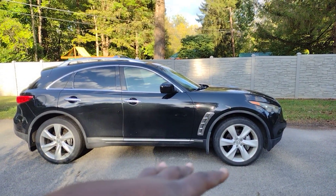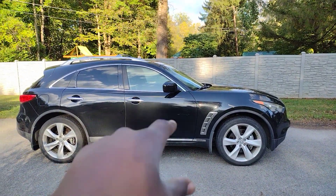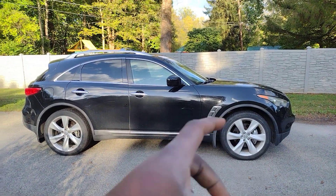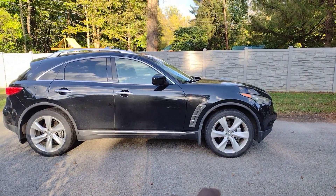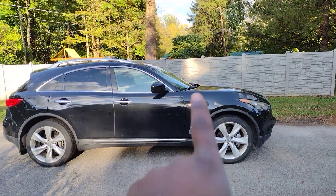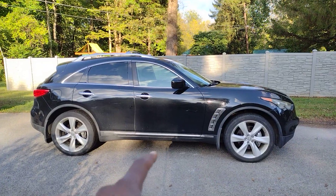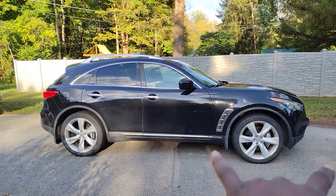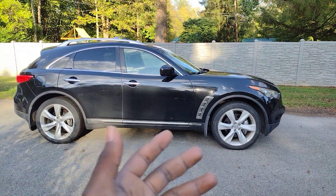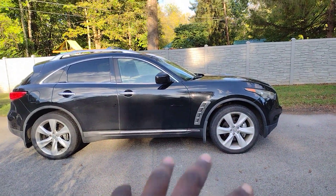The difference is that I don't drive it onto any special ramps or anything like that. In my test I use factory-appointed lifting points for the vehicle, and I usually do it for the front. I do it because one, I'd like to know, and two, it's a convenience thing — whenever I'm servicing both the front axle and the rear axle on one side I just lift one side and raise it high enough until both wheels get off the ground.